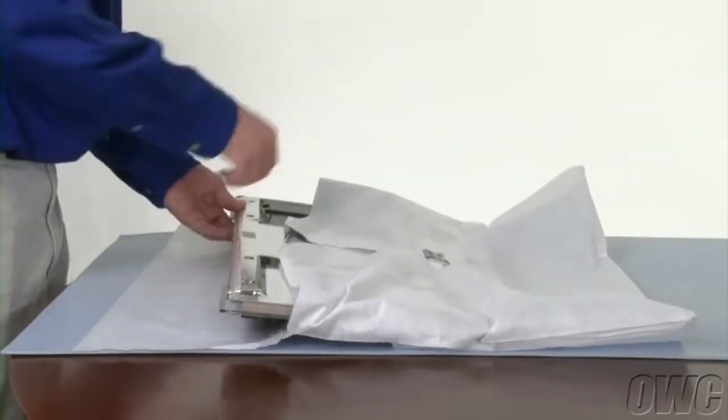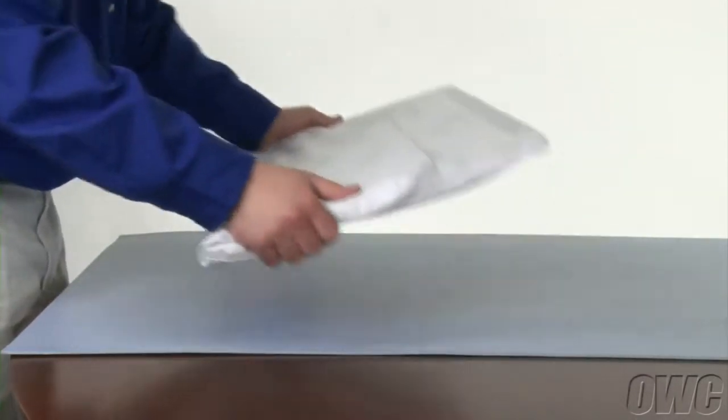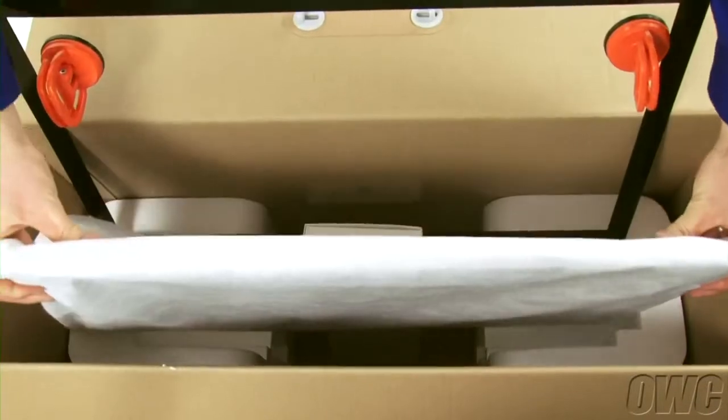Keeping your hands on the outside edge of the display, you can now lift it up and out of the iMac and place it in a dust-, static-, and oil-free place. We recommend using the bag that covered your iMac when you first purchased it. The screen in its bag can now fit in the indented section of the Styrofoam inserts.